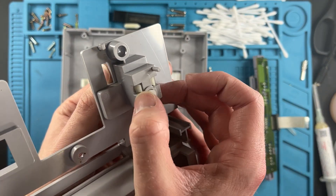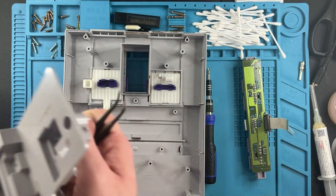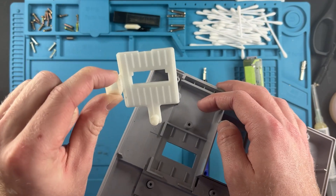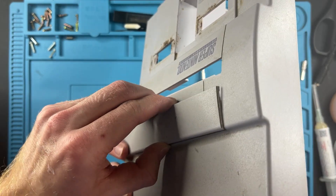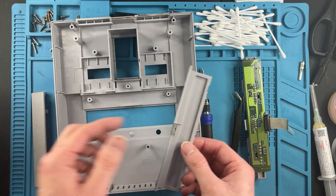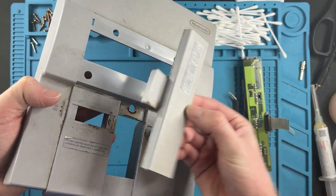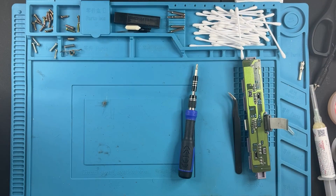To remove the power button, all you have to do is squeeze these two ends here and that will come out - toss that in the box. Now we can remove our buttons by squeezing these tabs - power bath, white slidey thing - throw everything in the bath as well. Squeeze these tabs at the end here, this will pop up this cover, which will allow us to remove the door very easily. I like to take the spring off - throw both in the bath. There's these two little holes, just push on them and it comes out like that.